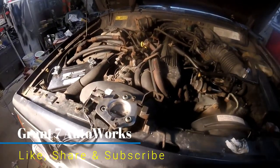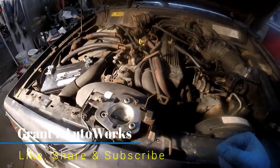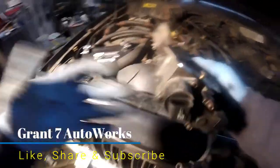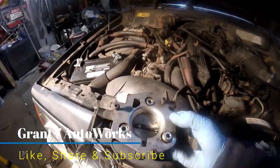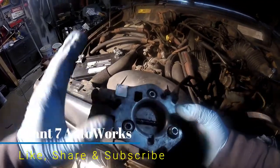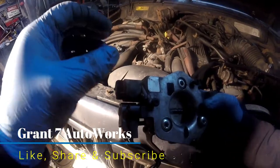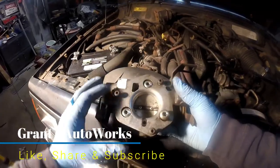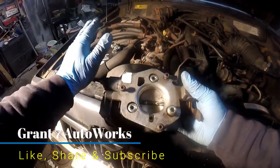What's up YouTube? Sometimes that stuff doesn't work, but if you've tried those and it didn't work, this is the guaranteed way to fix your idle. So this is the throttle body - this one is out for demonstration purposes. Whenever you have a high idle situation, first thing you should check is this sensor right here. This is your idle air control valve, your IAC. Basically what this does, when the boot is on here, it regulates the air at idle.